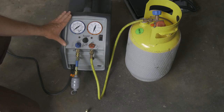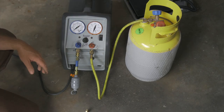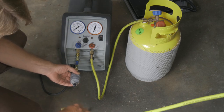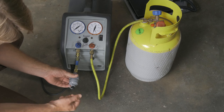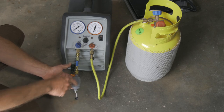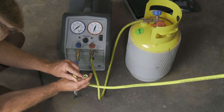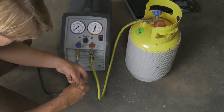So here we have a recovery machine so we can safely pull the Freon out of the car, and it will capture it into this tank here. That's where we're going to hook our middle line — where we would charge Freon, do our vacuum — and this is also going to be for recovery. We did have to purchase a couple pieces. This is a half-inch to quarter-inch adapter to our filter. If the compressor or there was trash in the system, this will keep the trash from making its way into the machine. It does have a Schrader valve on it, so we need to make sure that our line has the detent inside of it. If it does not, then we'd have to remove that Schrader valve to keep the system flowing.